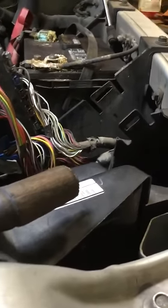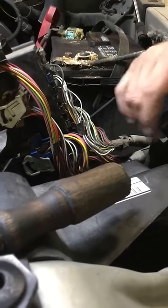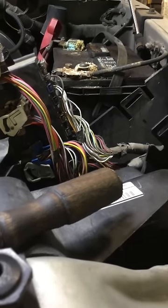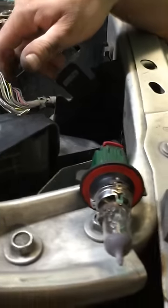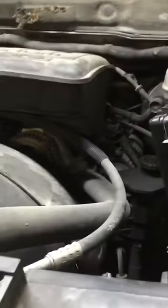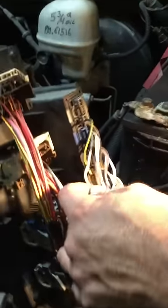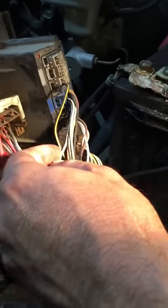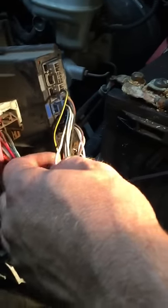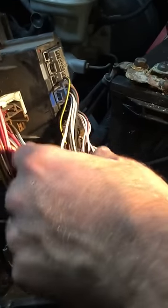You can find a wiring diagram online. You're looking for the low side headlight drivers. If you've got an 06 RAM, or any 06 probably, these are going to be pretty much the same — they might be a little different. I got the Dodge wiring diagrams, and that's basically what the wire colors showed: white with tan, white with blue — both low side drivers.